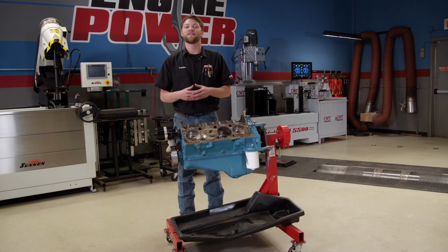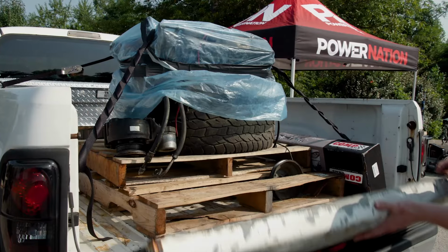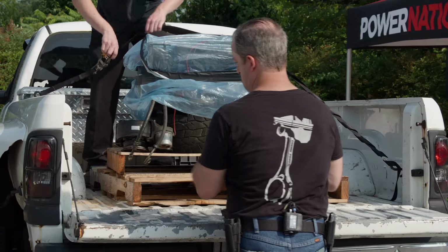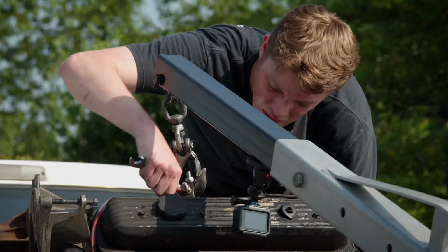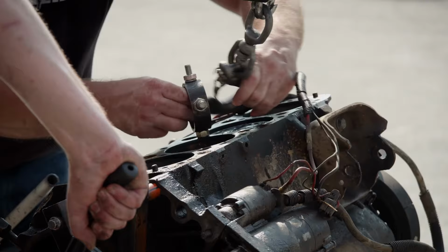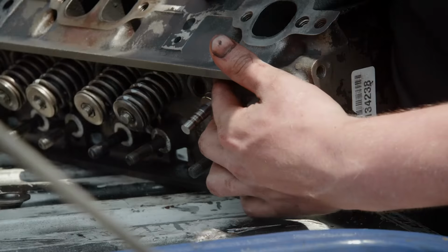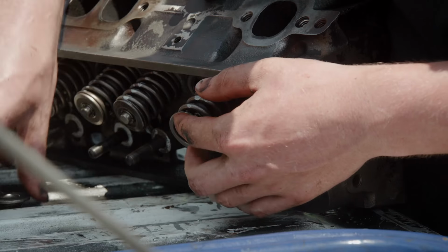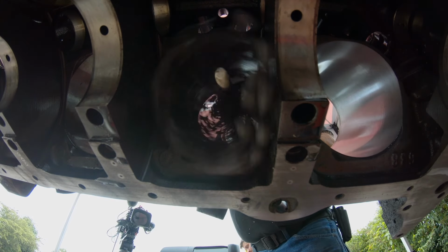refresher, here's a look at the evolution of this power plant. The first time we worked on this engine, we wanted to recreate the backyard build experience that many people have at their home. We found a well-used and worn-out engine, then took it, some extra parts, and some simple hand tools outdoors. We gave the engine new seals and valve springs designed for a sportier hydraulic roller cam, and refreshed the cylinder bores with a 320 grit ball hone.